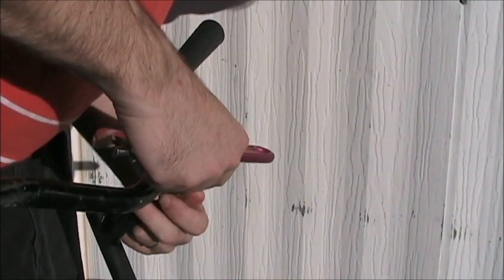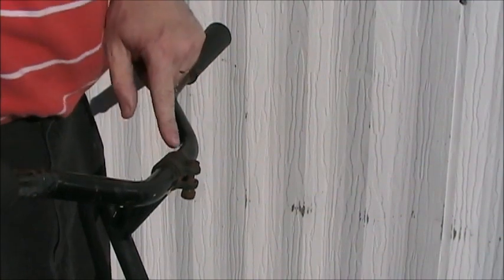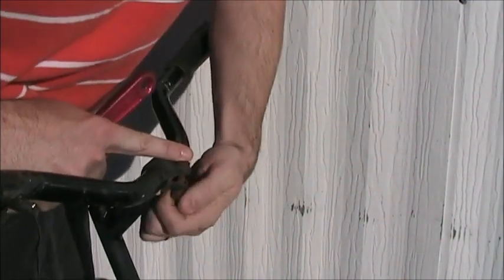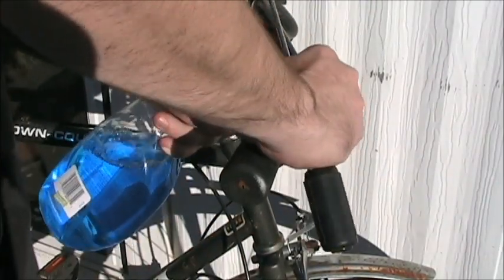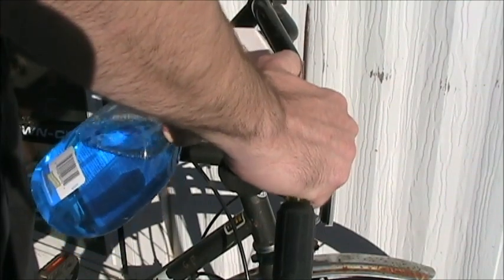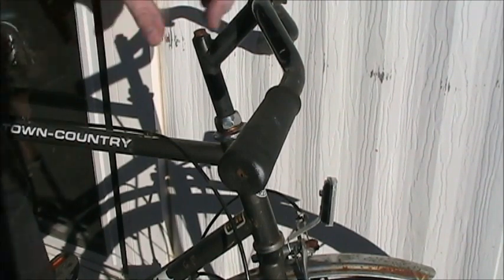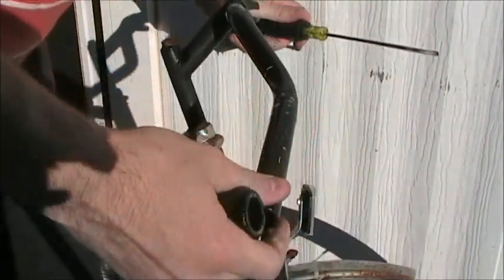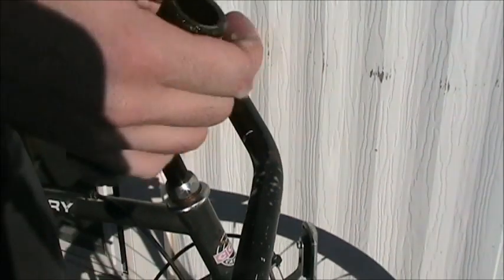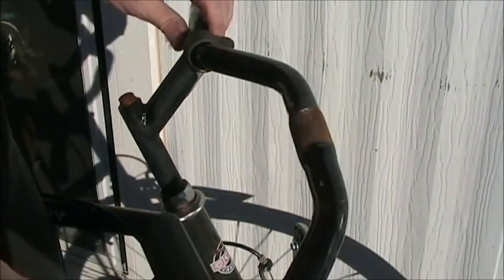Re-secure this bolt down tight. Next we're going to loosen this bolt. It appears we might actually have to flip the handlebars around, so we might have to remove them from this bracket and put them back on. If you find that the grips are hard to come off — because very often they're rubber — use a little window cleaner like Windex or something along those lines. It's a lubricant. Like soap, you get it in there to help slide them off. Then you rinse it off and you can probably reinstall it. Off she comes. We'll rinse this off and then squeeze it back on the other way.